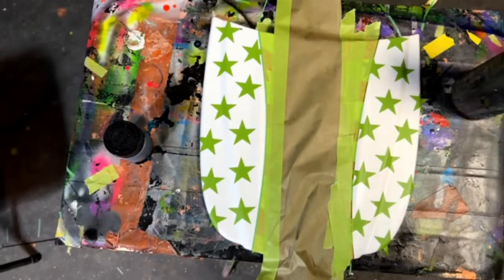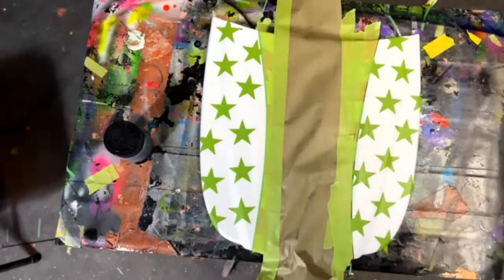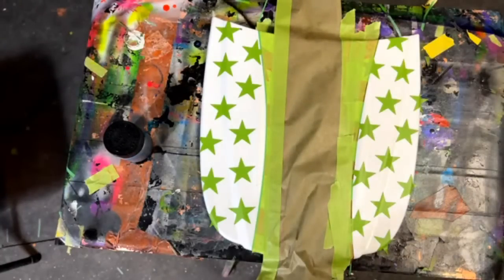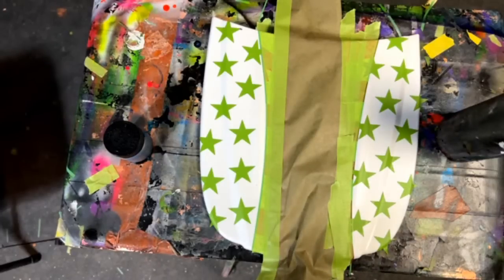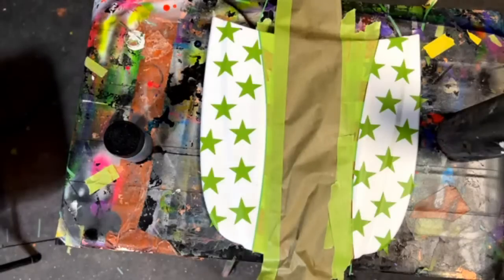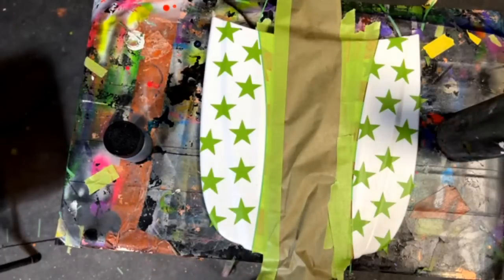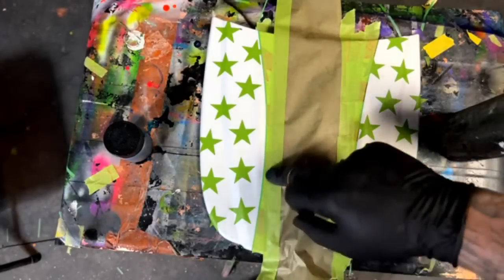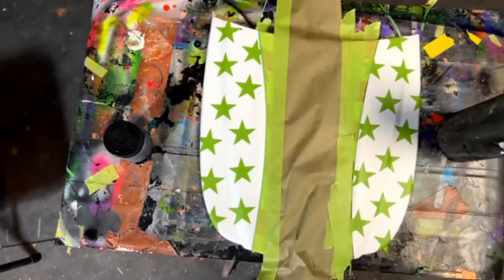If you plan on airbrushing it, don't use regular clear coat. If you're doing a full complete, maybe you can get away with it. In fact, I know you could, it's just a little more risky. If you're new to clear coating, don't do it. Just put it in clear base coat. If you plan on doing graphics or any tape lines, it needs to be clear base coat. Clear coat is going to build too much around your tape, build a thickness, and cause all kinds of problems. And it doesn't dry until hours later.